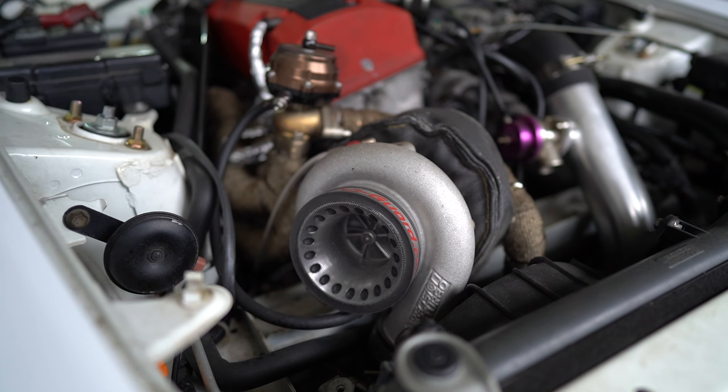We also need to do an oil change on the car for the season - I didn't change the oil at the end of the season. Changing the oil on this thing is rather difficult. You have to take the downpipe off to be able to get to the oil filter, just the way it was built and engineered. You just got to take the downpipe off, move the rest of the exhaust out of the way, and then you can get that oil filter off. We've also had some issues with the pancake fitting in between the oil filter and the block where the oil comes out to feed the turbo. We need to get a new one of those fittings - I think we just got a bad fitting in the beginning that never really seated right. It was a Summit Racing branded fitting and the quality control on that is a little bit lax.